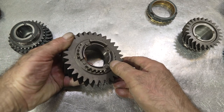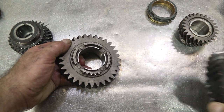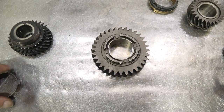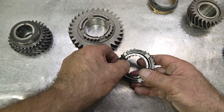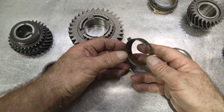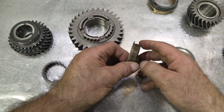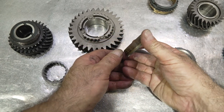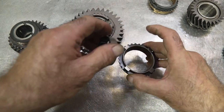On the first/second gear: the world-class gear has no cone on it, while the non-world-class has a cone, so the synchronizer ring rides directly on the cone. On the world-class one-two synchronizer, instead of a simple bronze ring they made a three-piece ring — an outer shell, a lining ring, and an inner cone. The inner cone is actually splined to the main shaft, and the lining is dual-lined on the OD and ID to increase surface area and give better stopping power. The newer rings have a serrated carbon fiber lining — the early paper-style rings can burn up, so upgrade to the better style ring.